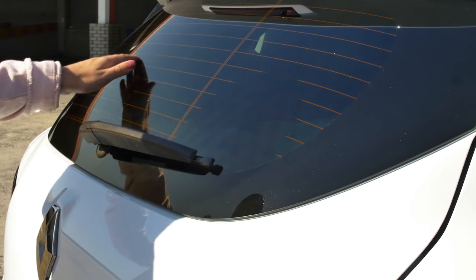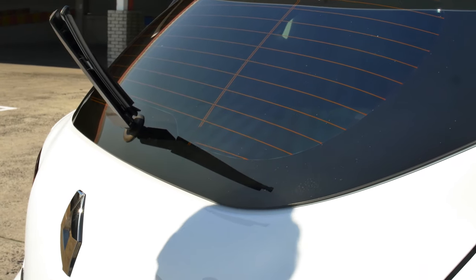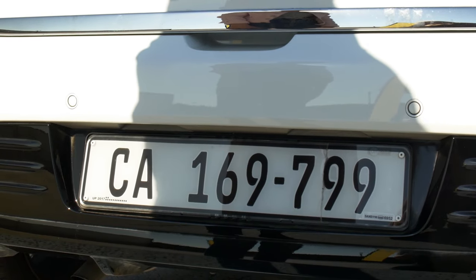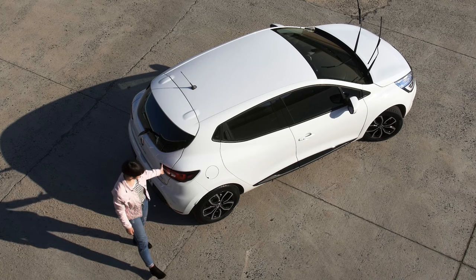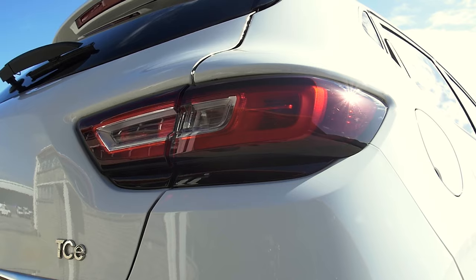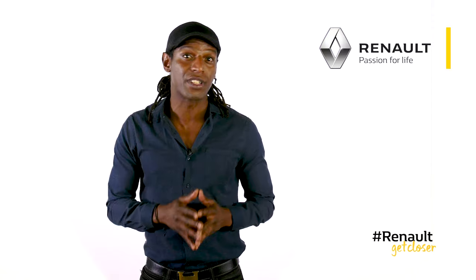Confirm that the back of the vehicle is not damaged and that the boot, exhaust and bumper are secure. Confirm that the rear windscreen is clean and undamaged. Check your rear wiper blades as per the front if applicable. Check the rear registration plate and lamp for damage, cleanliness, stability and validity. Point to the back right-hand light and reflector cluster and say that the lenses and reflectors are not dirty or broken. Check the right-hand rear tire and say it has been checked in the same way as the other tires.